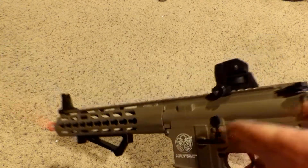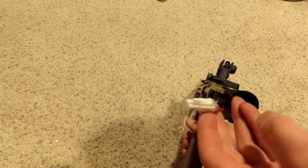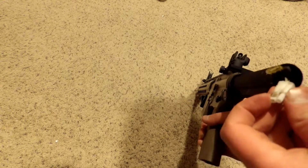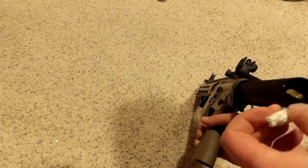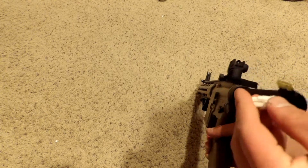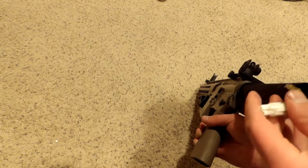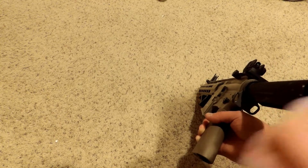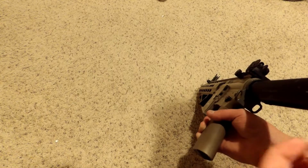This is a short video, but it's good info for beginners. If you're unplugging and replugging your battery a lot — like if you have an 800 milliamp-hour battery — it's really going to kill the Tamiya connector fast. Even at only 8.4 volts without a lot of current, the pins just aren't made to be inserted and removed repeatedly.